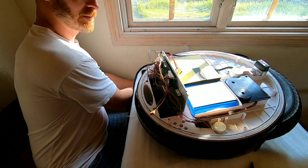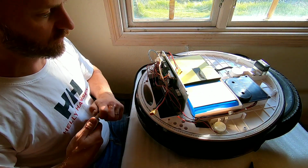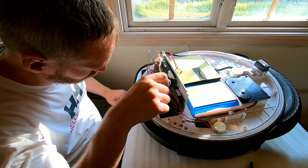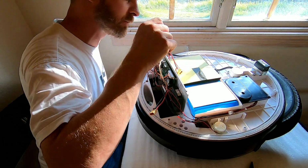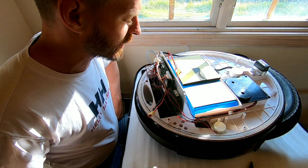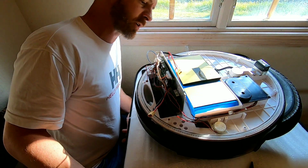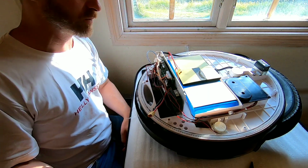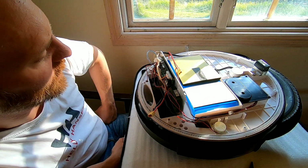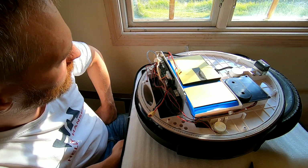All right, so everything seems to be well. I'm just gonna finish off here. I'm gonna take a little bit of silicone for the Bluetooth board, some for the Hall sensors. Yeah, I'll probably just dab some on here as well to make sure things are reattached. Yeah, probably not. I'm still not sure whether I'm actually gonna open up the board later and replace the thermal pads with TO247 individual self-adhesive thermal pads instead. In which case the silicone will be an issue.